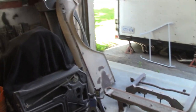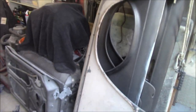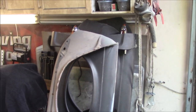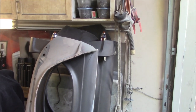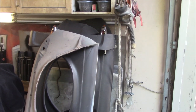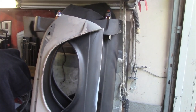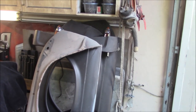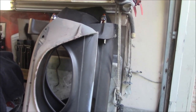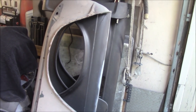Again, most of them have been epoxied on the inside with black epoxy. I think there may be one or two that I'd have to go back and have a look at. I don't think I did all of them, but we'll make sure that we have a good coat of black epoxy primer on the inside of each of those fenders before we do probably just some high-build urethane primer that we can sand down quickly. And then we'll end up doing a top coat of Raptor liner on the inner fenders. So the objective, of course, is to do the exterior of the fenders in a polyester primer, but we'll get to that point in the future. I'm going to do the back sides of the panels first, followed by the top sides.